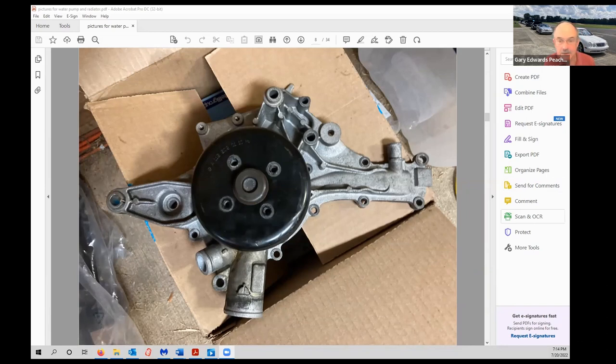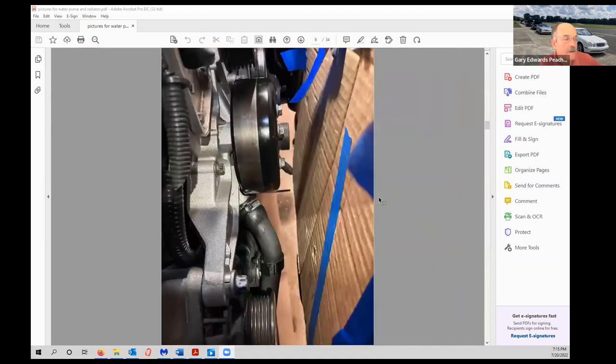For sequencing this job, it's a lot easier to do the water pump and radiator together — not what I did, but it gives you more clearance for the water pump work, less chance of damaging the radiator, and the bolt for the upper idler pulley can't be removed with the radiator in position. If you have a high-mileage car and need to change the water pump, and the radiator has never been changed, probably go ahead and change them both.